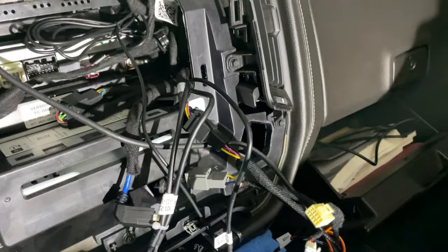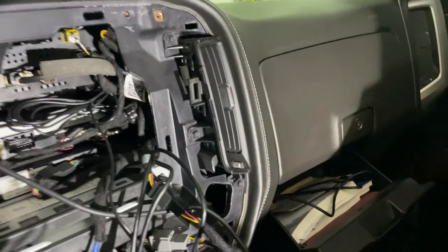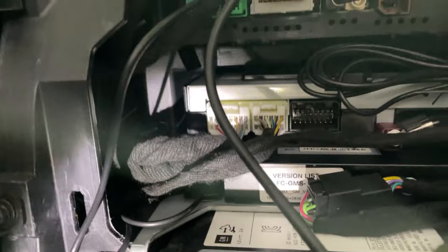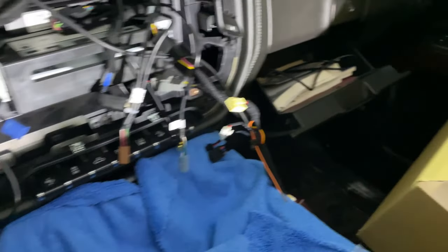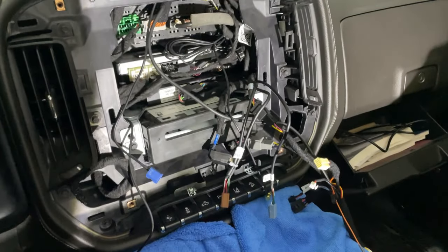There are the two wires I pulled through from the glove box into this main compartment area. The next thing I'm going to install is the little speaker — it needs to be installed inside of here somewhere, I'm going to try to locate it back there. This little pigtail harness is going to connect into the plug on it, and then the purple side is going to plug into the actual monitor itself.